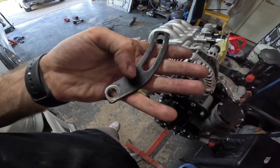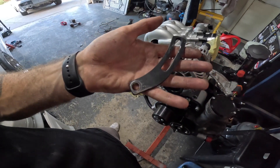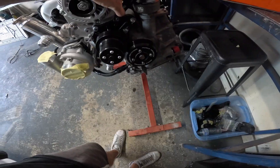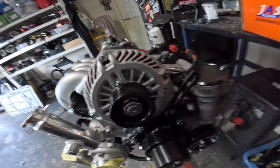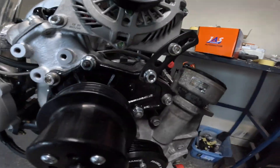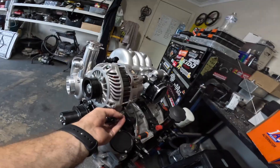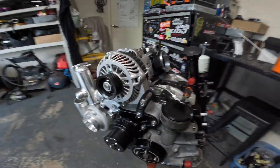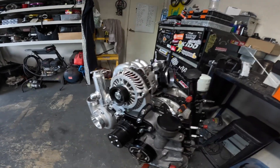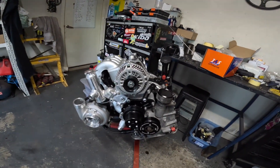Well, that didn't work — she needs to be shorter. So let's draw the hole a little bit higher, pretty much at the bottom of the adjuster, and go for it. Take two — hell of a lot shorter now. I'm actually going to mount it in reverse just because I reckon it'll give me a little bit more room without fouling the top on the body of the alternator. Chuck some hardware in there quickly — and just like that, the bracket's on. Just have to whip it off and give it a little bit of a touch of paint. It's got plenty of adjustment — as long as that top one's loose and the bottom one's loose, you can rotate it to where it needs to be. Just need to cut a belt, work out the size I need, and it's good to go. LS alternator — done.